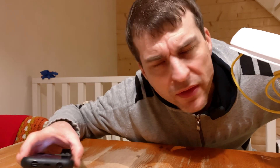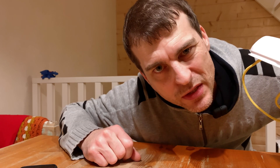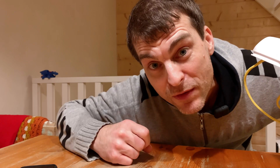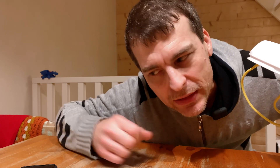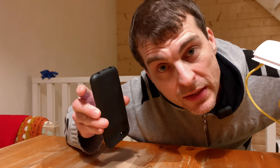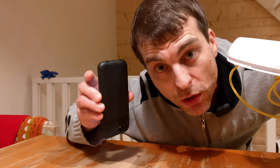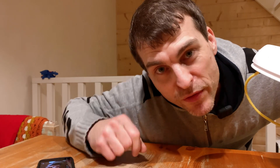I have seen some people think: why would I want my Wi-Fi router closer to my head, or closer to the ceiling, or closer to me? Aren't those extra Wi-Fi signals going to get me? Look, if you're worried about Wi-Fi signals in your house, they're probably in your house already. And unless you're going to install a Faraday cage, I recommend making sure your own Wi-Fi at home is not hiding in the corner, because that actually makes the router work harder. The phone says 'I can't hear you, speak louder,' and the Wi-Fi router says 'okay, let me shout from the corner' and it pumps the power up. The same with the mobile phone — if it has a weak signal, it starts increasing its power. So the best place to put your Wi-Fi access point really is as close to the device you're going to use with it, and on the ceiling is a good place to put it.